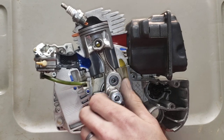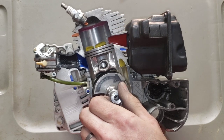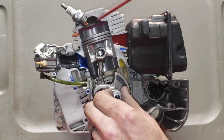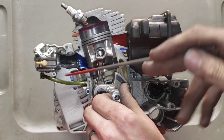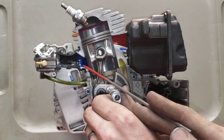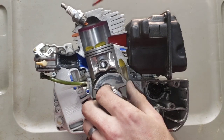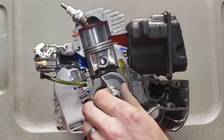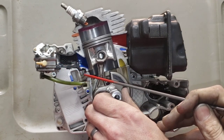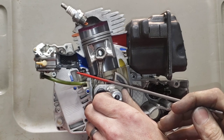If you're familiar with four-strokes but not two-strokes, you can think of these port heights as your camshaft lobes — they're what opens your intake and exhaust valves. In a two-stroke we don't have a camshaft, so we can adjust when the ports open by changing these port heights. You always hear: lower the intake, raise the exhaust.